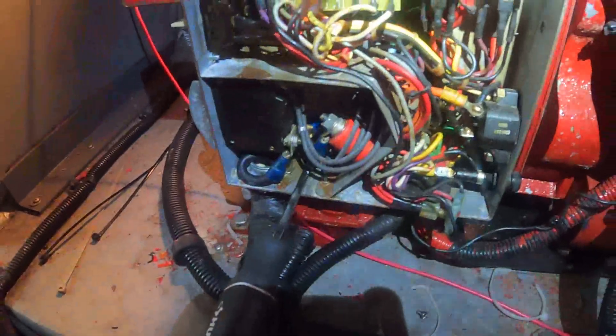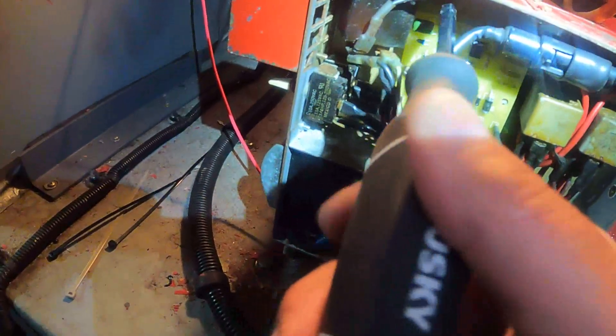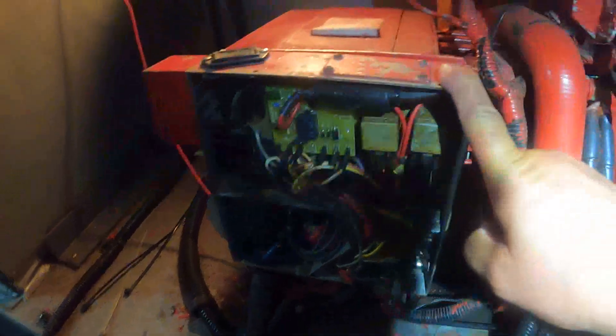I'm making progress. There's no way to possibly show you where these screws are with any kind of accuracy, so I'm showing you with my screwdriver — it's probably the worst part because it's almost blind. You've got to find these screws by feel. There's a screw at the bottom — my screwdriver's in it now — it goes through this control panel base and screws into the main unit. There's one up here too. That's why you don't want power coming to this thing. Now it's tight — this control panel is back on. Let me install this cover. There's a little trick to it too.